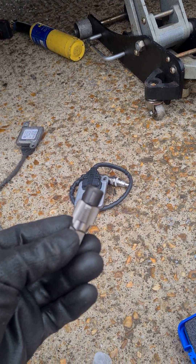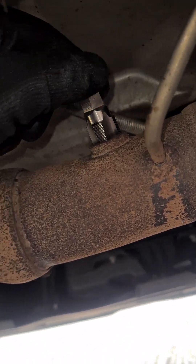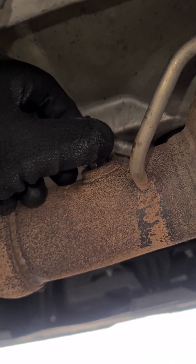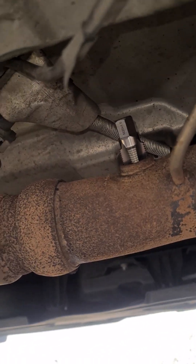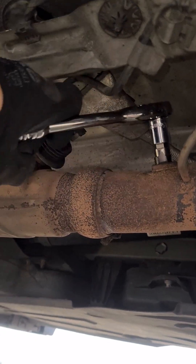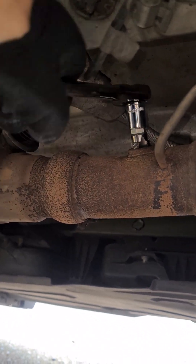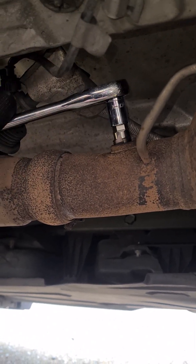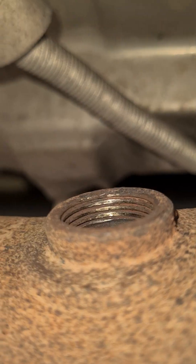These tools have a piece in the middle that centers it when you put it in the hole, making sure the tool is centred so you're not putting it in off-centre and making it crooked. I'll just get that in there, make sure it's getting some bite, and then get a spanner on it. Even better — we managed to get a socket on there. Now we'll just cut our way down and get that thread cleaned up. Hopefully we have enough material left to cut a new thread in; if not we'll have to use an insert. That's it — we've reached the end.